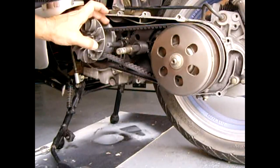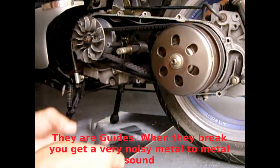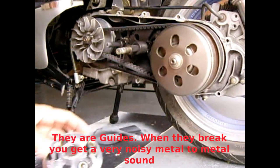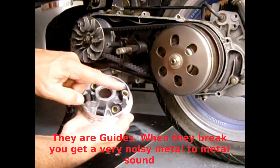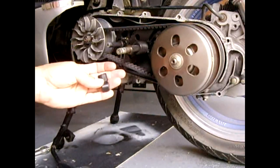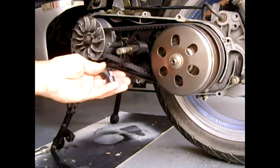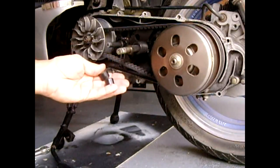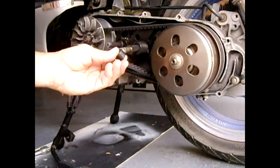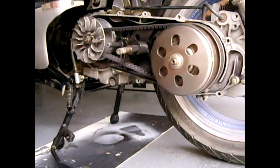I have changed parts in the assembly such as these little plastic guides that slide over the variator on these posts, as well as the rollers. I've used sliders and rollers, and to me the sliders are a lot more money and a waste because they wear out just as fast as these rollers do, so I'd rather just change these out when mine go bad. But everybody has their own opinion — if you like the sliders then stay with those.